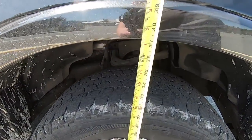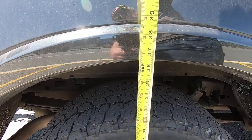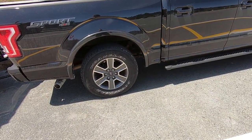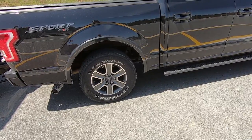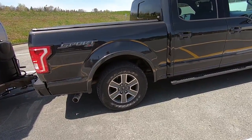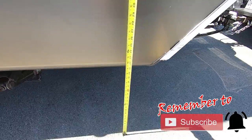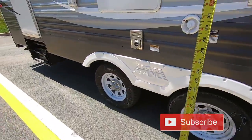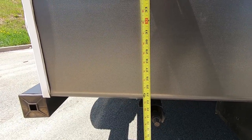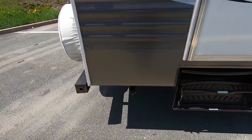We're just a tick over 37 inches in the front and about 36 and a half in the rear. That's exactly how I wanted it — I certainly didn't want any additional height in the rear compared to the front, as that means you're overloading the front of your truck. A slight squat is exactly what I was looking for. I'm showing about 21 and a half inches to the bottom of the fender at the front, and 23 and a half at the rear — so two inches over 30 feet. I think we're doing pretty good.